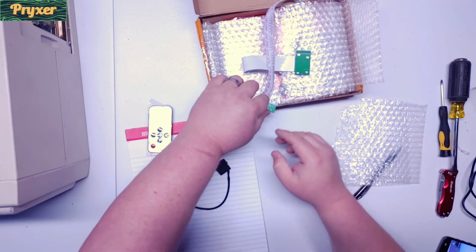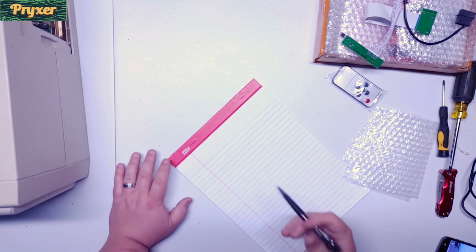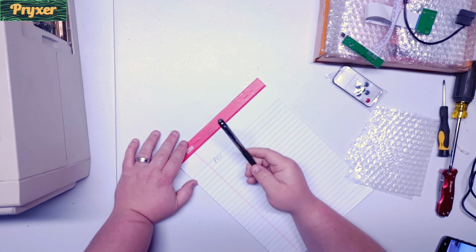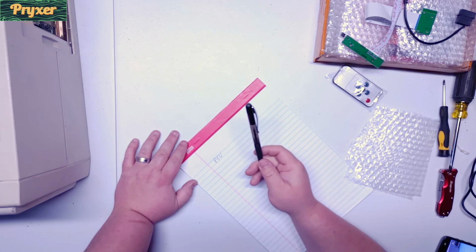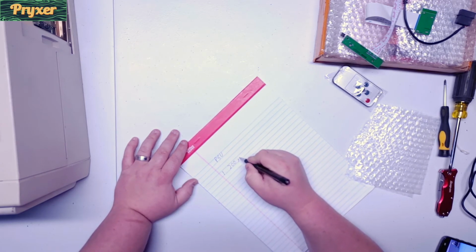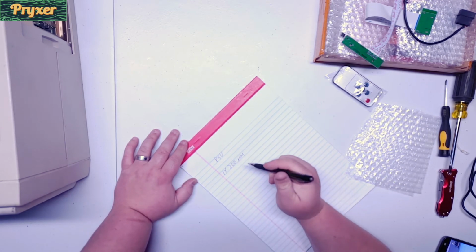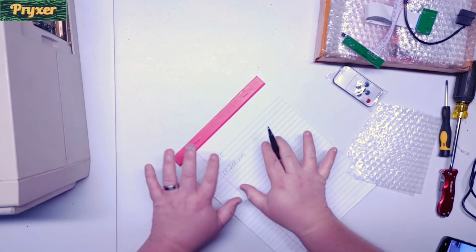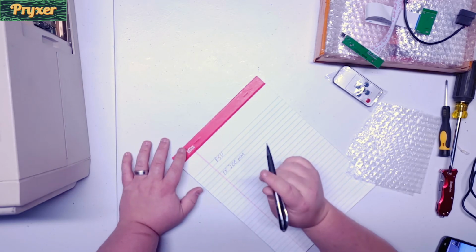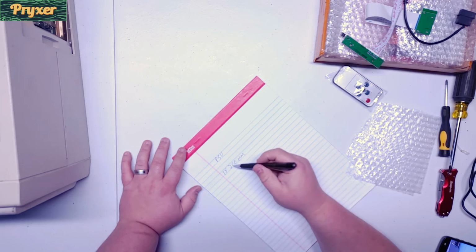But yeah, so we're going to need, for sure, I don't have any power supplies in stock, so we're going to need a PSU. We're going to need to do some testing on the airflow once we get that sorted out. So what I'm thinking is we're going to do one 200 millimeter in the front, drawing air in. That way it's not pushing warm air out on your fingers when you're on the keyboard. So the front will be the intake. So we'll intake air from the front. So we're going to do 200 millimeter there.